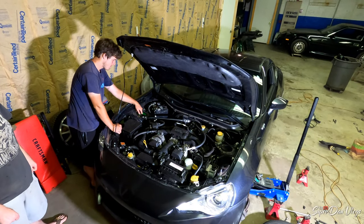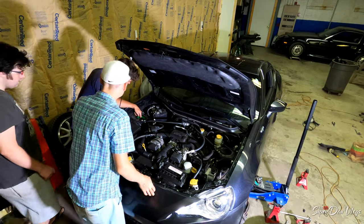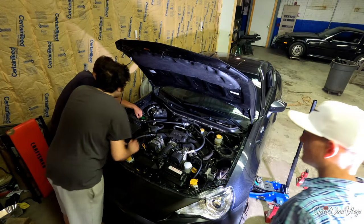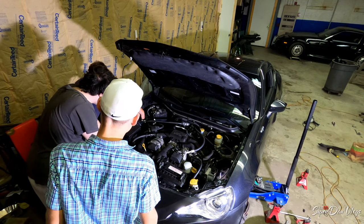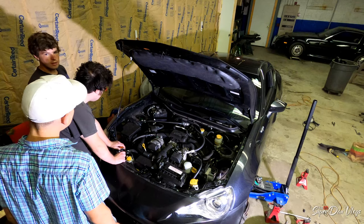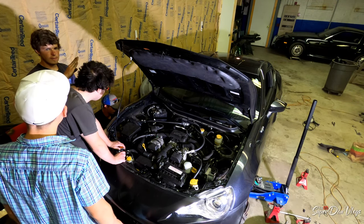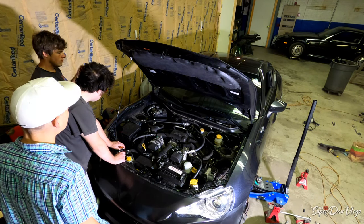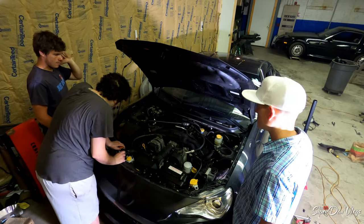Yeah, that's a much better angle. Swapping them? One second. Hey, less caster, but we need more camber. I'm sure it's less what? Caster. What do you mean? Less caster? Yeah. So when your coil tilts towards the back of the car, that's caster. That's what brings your wheel back to center. Oh, so there's going to be more toe, you mean? No.